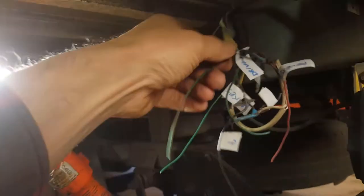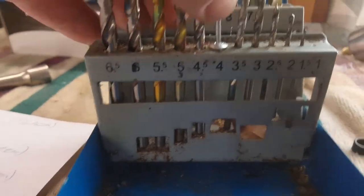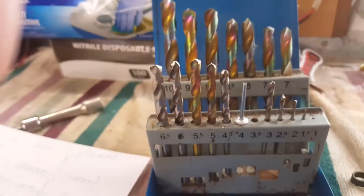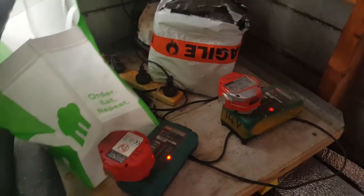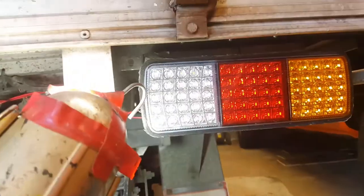The brakes, indicators, and driving lights — just make sure that these stay on, keep pushing them up as far as they'll go so they don't fall off. Four millimeter rivets — that goes into the four millimeter but not the three — and I'm going to use the existing holes here, so I'll drill these out. Don't forget to put your batteries on charge before you need them. I've got the center of my bracket — that's 13 centimeters from there to the middle.